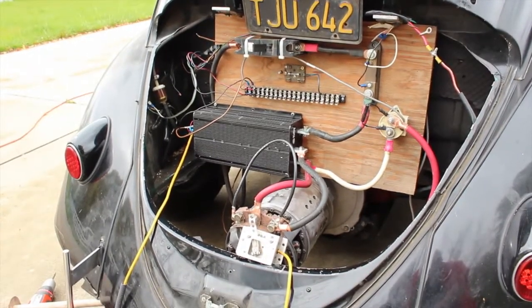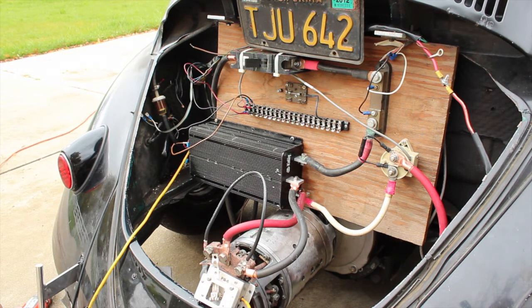We're going to put some video on this. This is going to be our first power-up. The controller in here right now is the 144-volt 800-amp Kelly controller series, running at 72 volts. It's a very simple, basic hookup: got 12-volt power from the auxiliary battery, a 2-pin PB6 throttle pot hookup, motor minus, battery minus, battery plus, motor plus. I've got a circuit breaker, a shunt, a contactor, and pre-charge.